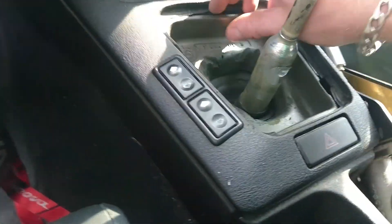There we have the original style shifter. The outside ring here — all the way around — needs to be turned clockwise in order to get the shifter out. Underneath, along the shifting rod, there's a C-clamp on the side that I need to take out. Then I can pull the rod out, unlock this, pull the whole thing out, drop the new one in — should be fairly easy. I'm going to dive under the car now.